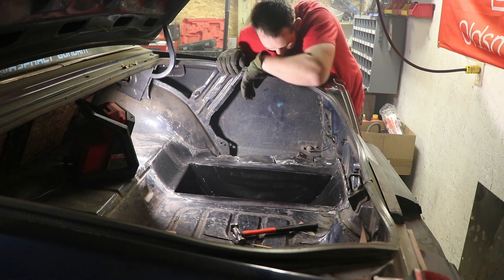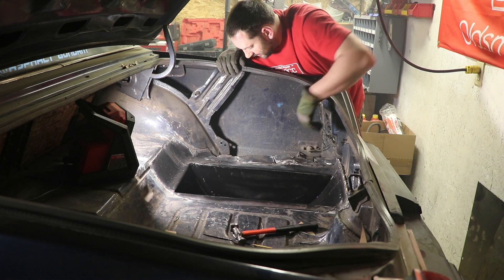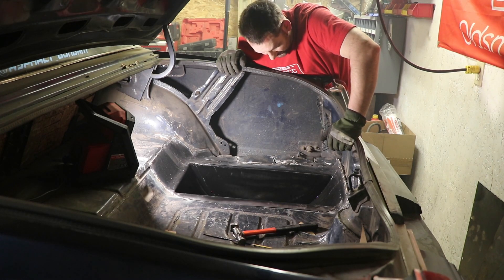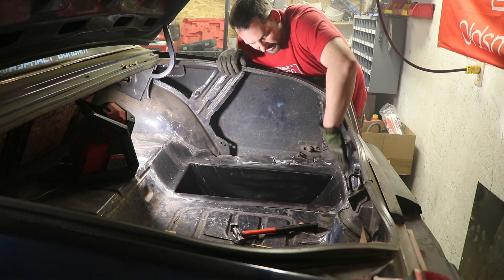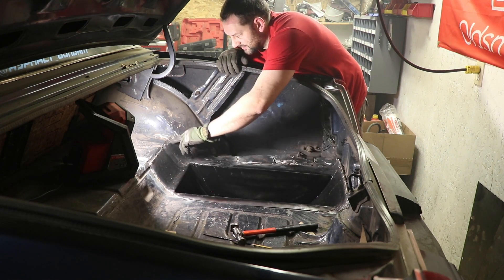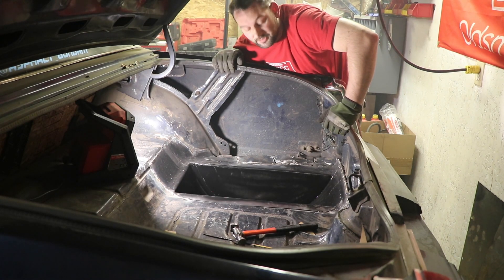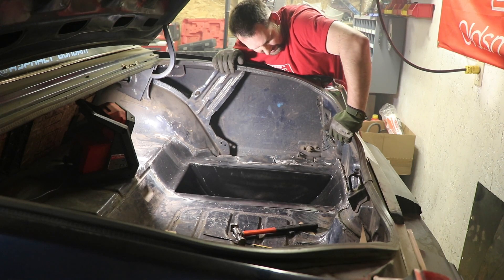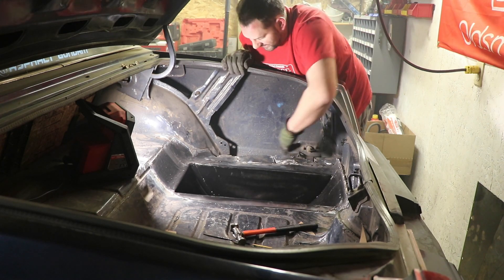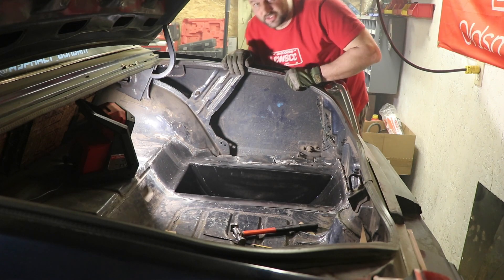Now I've got it welded in for the most part. There are a few spots where either the base metal just wouldn't take a tack or had a little too much gap, and other spaces where a previous cut to get a body bolt is just too wide to patch up - so all this will be getting seam sealer. I'll grind the welds down just a little bit to smooth it out. There are spaces where it gets into crazy contours, but I've got probably a solid 30 inches of weld all the way around this thing going into multiple panels, so it should really strengthen up what's back here. The key thing was to make sure we can fit this full size spare.